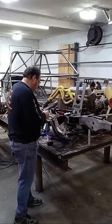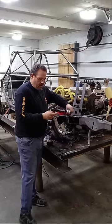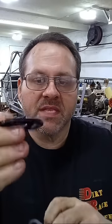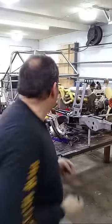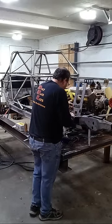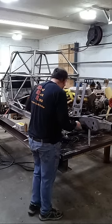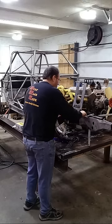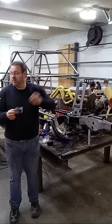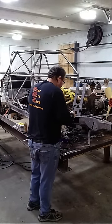So these work the same way because this control arm is slotted right there. But you don't actually need a slug for both of them. See, that one's a blank, so the bolt could go anywhere through it. And then this one's the set one. And see, that's a 0 right there. So they go in like that. Yep, just one. I don't need but the one. I don't even need the other one, because that's just a movable one. Put the 0 in right here.